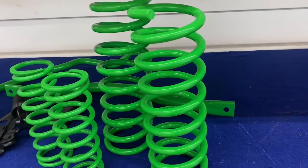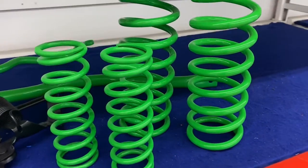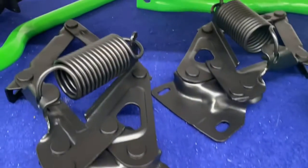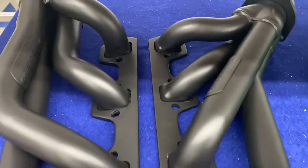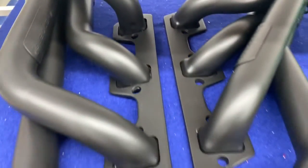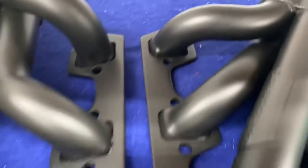Here's a little powder coating work — all the springs, sway bars, and the crossbar were done in racer green, which is a pretty high-gloss bright green. The two hood hinges were done in matte black powder coat. The unequal length shorty headers were done in Cerakote Glacier Black, which gives a nice smooth finish. This is an air cure — it does the final cure once placed on the motor and run for an hour at idle or under mild driving conditions, then let cool.